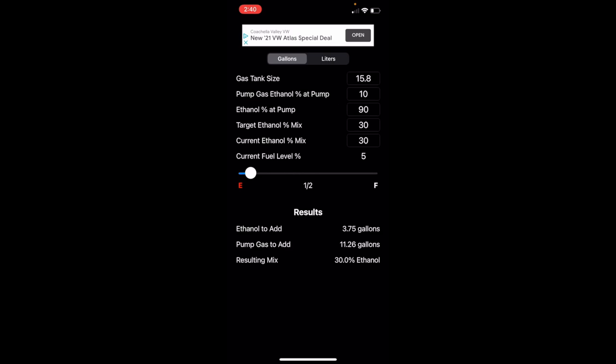Make sure this number matches whatever tune you're running. Always remember to go out and test your E85 — even if you're running an off-the-shelf map, it's a good idea to do it. I was doing a custom tune with Kerry Jordan and we ran into some issues with knock events and timing. He actually recommended that I try a different gas station, and sure enough, going from 76 gas to Shell, my knock events went away, my timing got better, and it does make a difference. At the end of the day, we are in control of what we put into our cars, so it's a good idea to test so we can get the longevity out of our engines and the performance that we deserve.